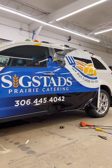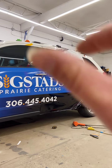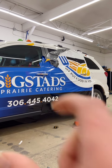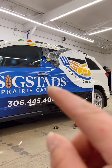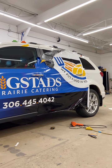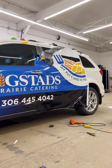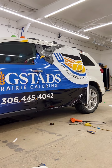In the event that the overlap was turned on and something just happened, what that means is that you put the panel on crooked. So it's not lining up because the panel's on crooked. What you're going to have to do is take this panel back off and try to realign it to make it straight. In this case, we can't because the door handle is already cut out, and same with the back one. If we put that one back on, it's not going to line up properly, and we already have holes cut, so if we move it, it's going to be off. So we can't do anything with this panel at this point. We're going to have to take it off and redo it.